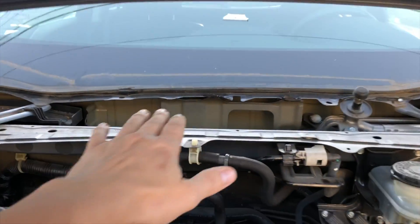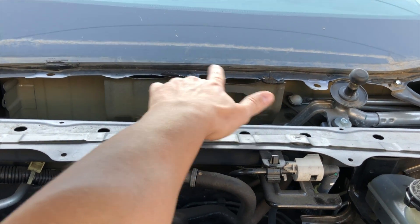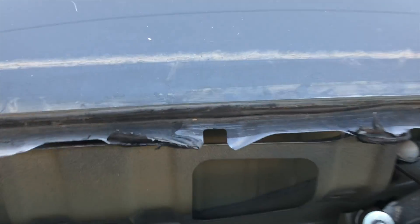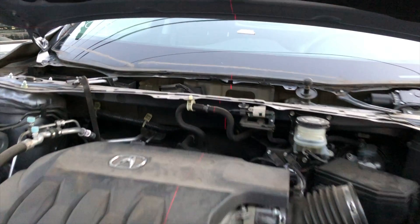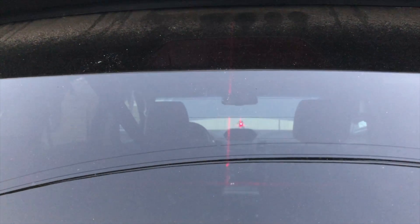Here's a tip: if you remove the plastic cover over the windshield wiper assembly, more often than not there's going to be something right in that area — whether it's a notch, like on this car, or just a hole. That notch represents direct center, and I've got it marked with a marker. That mark should match up exactly to our mark on the masking tape. So now the laser has to be positioned so the laser beam passes through the mark in front of the car and also the corresponding mark at the rear — so the beam is splitting the car down the middle exactly.